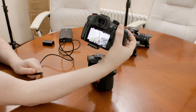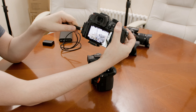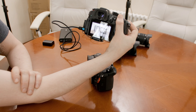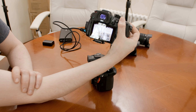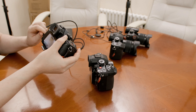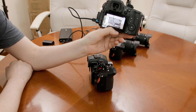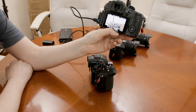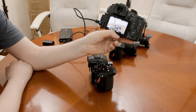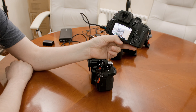If you plug a normal USB quick-charge port cable into the USB-C port on the camera, it says: "USB power is supplied from the connected device. Please turn off the power when charging." What it basically means is it is powering the camera from the battery bank, but it can't charge the battery at the same time because there isn't enough current.